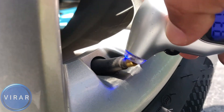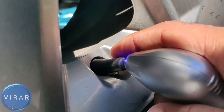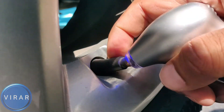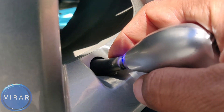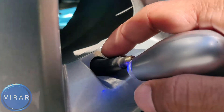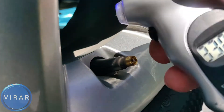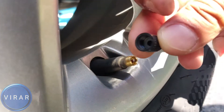It's very important that you position it exactly parallel and then push it in. If you do it any other way, it's going to leak air. I'm going to show you what happens when you do it the wrong way — I'm losing air over there. I'm going to check the pressure again to show you that initially it was 33.7, now it's 33. So we lost some air right there.